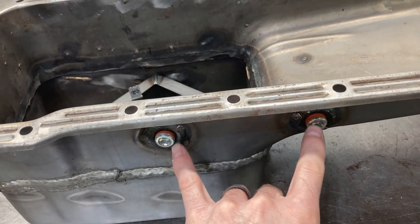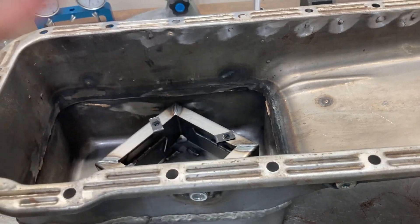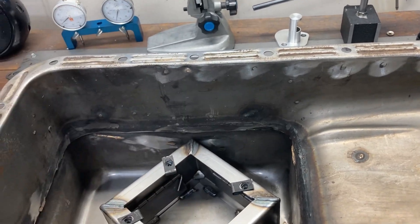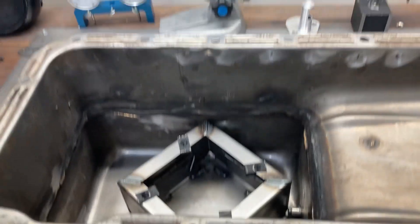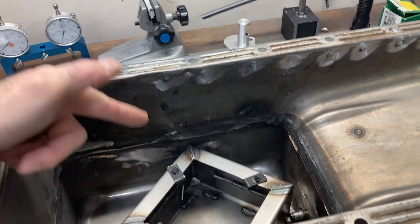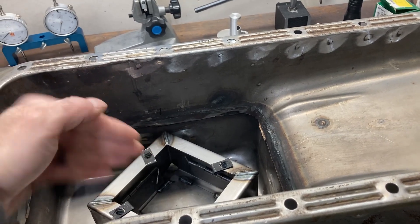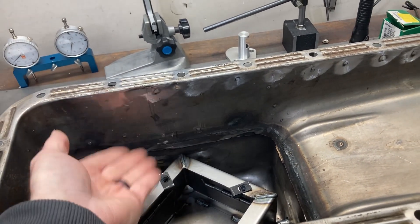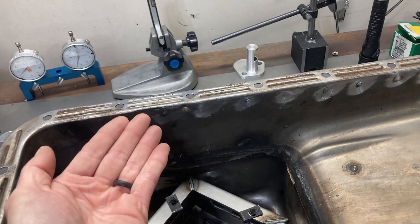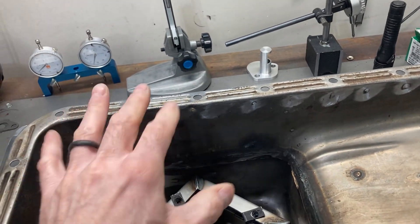Both drains are on the same side, and here's why: because of the crankcase movement below the pistons. The crankshaft turns clockwise, so putting the drains on the driver's side helps that drain movement. If you put one on the passenger side, crankcase air pressure or gas gets pushed back up your drain line into the cylinder head and you don't get a good drain.